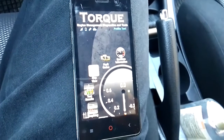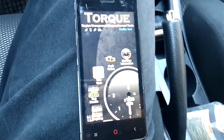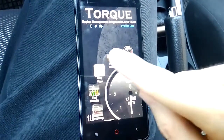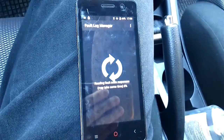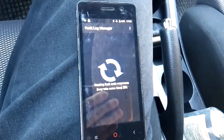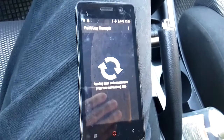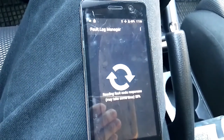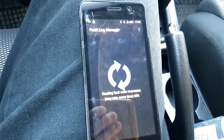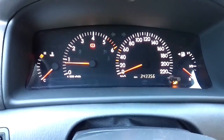I'm happy to say I've identified the problem with my engine fault light, and it was a very simple thing I overlooked. In the Torque mobile app under faults — while it scans — the problem was that I was trying to delete the engine fault codes while the engine was running. Apparently you can't do that; it's impossible to delete any codes with the engine running. What I had to do was switch off the engine while keeping the ignition on, and that's when I could safely delete the code. I'll now switch the engine back on.